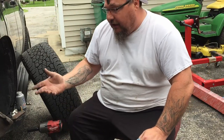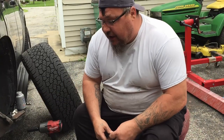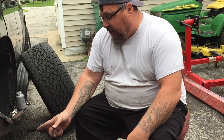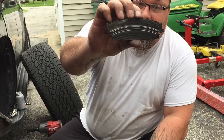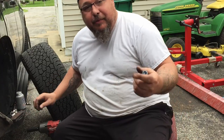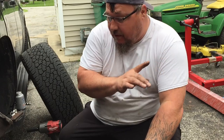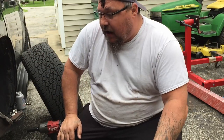Alright guys, we got the driver side done, now we're over here on the passenger side. I figured I'd throw this clip in to show you how easy it is to change your rear disc brakes on a 2010 Tahoe. All there is are two 13mm bolts that hold the caliper on — no need to take the caliper bracket off, which is an 18mm bolt. The back brakes were definitely in need; we've had this truck going on five years and I've never touched the back brake pads. Pulling that trailer to the west side of the state — three and a half hours, stop and go — without a brake controller really took its toll.